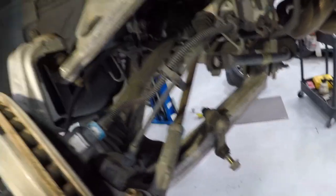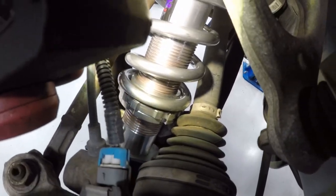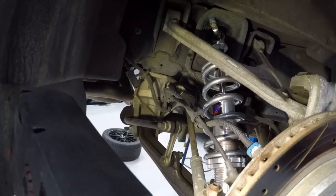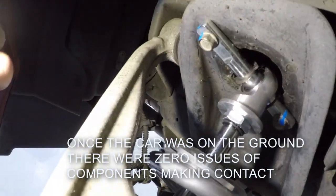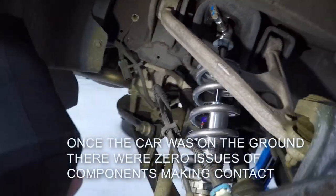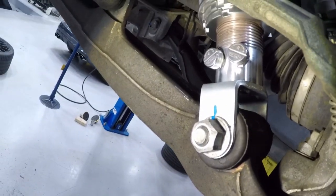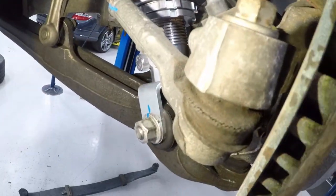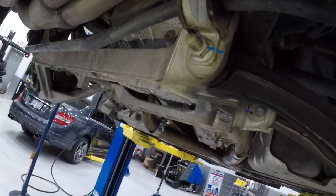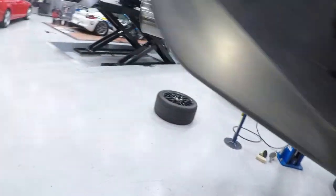It's the next day now. I went ahead and put the lower control arm back on. All I have to do is assemble the coilover and mount it into the car. I already did this on the other side so I knew what was going on. There's a bit of a clearance issue between the axle and the spring - you're just going to put more negative camber into the lower control arm and raise up the spring perch a little bit. Overall it's a good piece - got the swivel joint up top, all mounted into the factory setting. It offsets one way so when the arm swings out it's even. Got your double adjustables on the bottom - compression and rebound. We'll set those up for the street and then change them for the track later on.